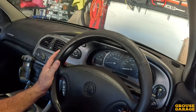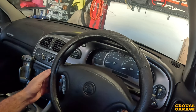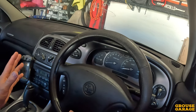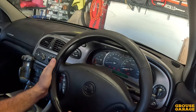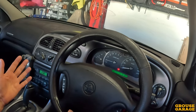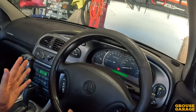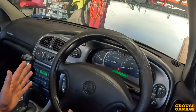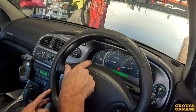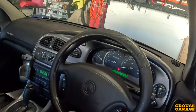I'm in the driver's seat now. Key's in the ignition. This will be the first start after flashing the PCM with that first modified tune. What I'm looking for here is the ability to start without having to touch the accelerator, and I'm looking for idle. Wow — did you see that? Did you hear that? Listen to that chop — hopefully you can hear that chop from that cam. That is really good. That's excellent. That's idling perfect. The idle looks like it's up to about 850-ish according to the gauge. That's fantastic — I'm going to get my belt on and we're going to go for a drive.